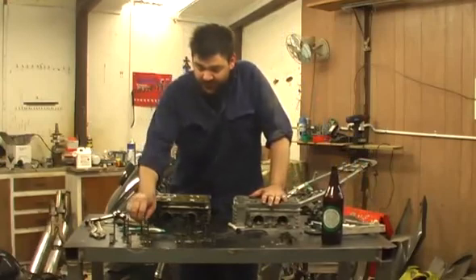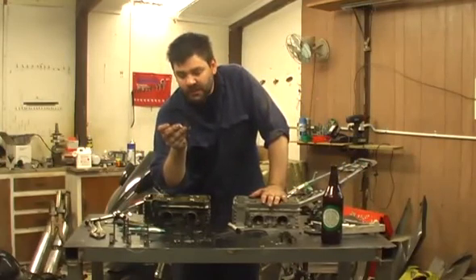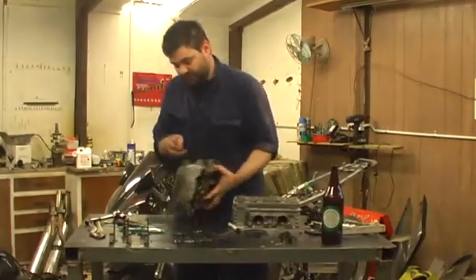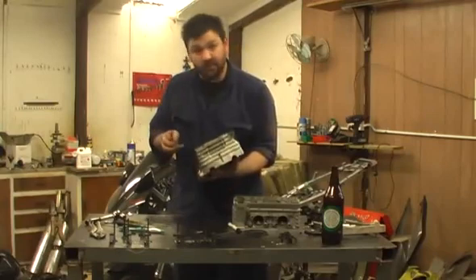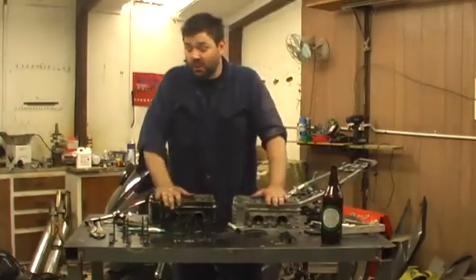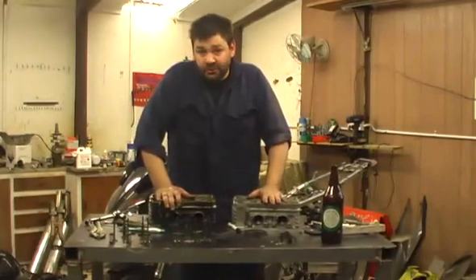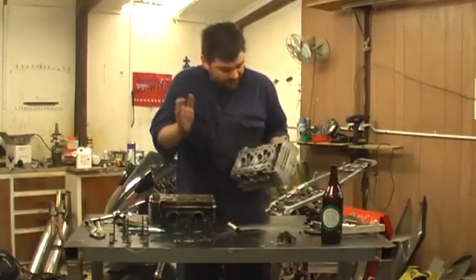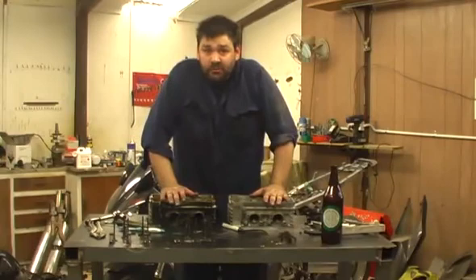Now it's just a matter of cleaning up some of these valves. There's a fair bit of carbon on these. The seals are pretty good, surprisingly, as are the valve stems. As you're sliding it out, you'll hear a nice little pop — put your little finger on there to push it and you'll hear it. There's a little pop with a good oil seal. The valve stems on this one are pretty good, which obviously means most of the valves are pretty good as well. It's just a matter of putting some valves in and lapping them all up, give it a quick tidy up. Then we'll have it reassembled and hopefully ready to go and put it back on the bike.